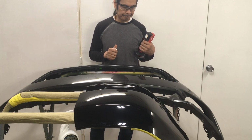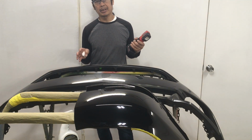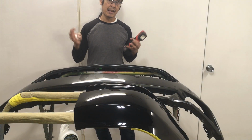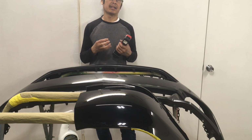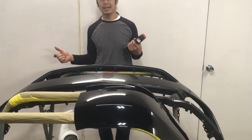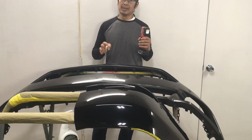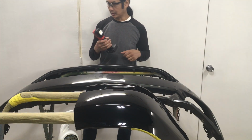Just like if you have an air compressor or a turbine sprayer, you don't wanna have anyone using products that can cause fisheyes, because it floats in the air. Then when the machine sucks in the air, it's gonna contaminate all the inside of it. Your hose is gonna get contaminated. Next thing you know, you're spraying something and you're basically creating fisheyes somewhere. So just be conscious of that, because fisheyes are not good. So there you go.